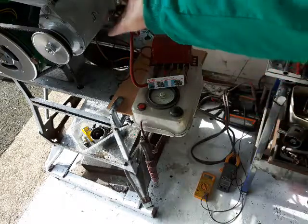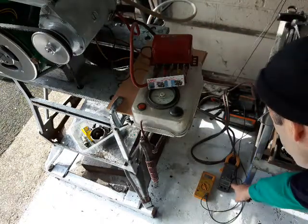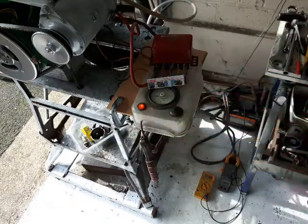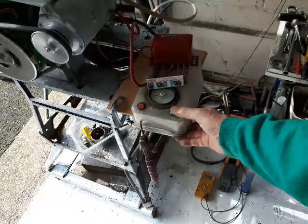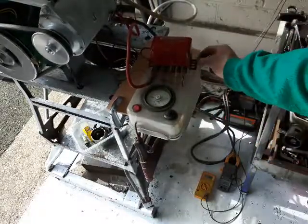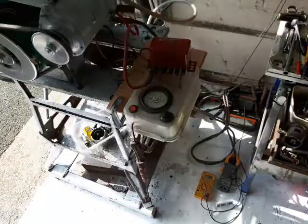I've got this connected up properly, and I've also got here a clamp meter to measure amps, a voltmeter on the battery, and I've also got an ammeter built into my little system here. I'll energise the system and start it up — you should see there we've got almost no current here until you're revving.